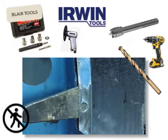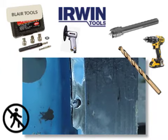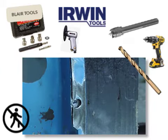So in review, we used a Blair spot weld cutter. It's a good tool. The teeth will eventually break. That's normal. Always use a pilot hole. 1/8 of an inch is good. It helps keep the cutting tool nice and straight. And don't forget to grind it flat to remove any imperfections in the weld.